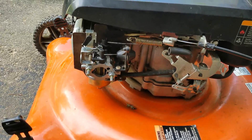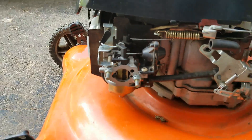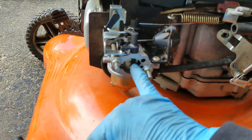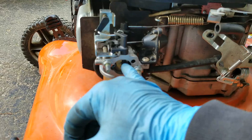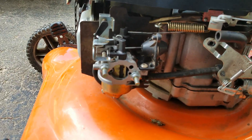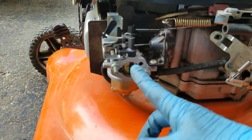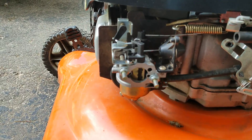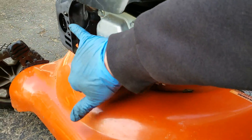So the system works in two ways — it has two separate ways of opening and closing the choke. Here's your choke plate right here, and the whole purpose of a choke plate is to restrict the amount of air that you're mixing with the fuel for starting. That makes more fuel than air, which we call a rich mixture, and that actually helps to get the engine started. Now if this choke plate stays closed after it starts, it's going to run rich, foul up your spark plug, and you're going to be puffing black smoke out the exhaust.